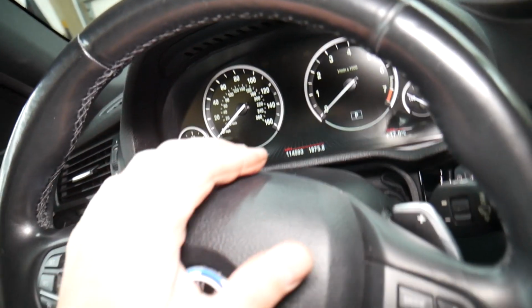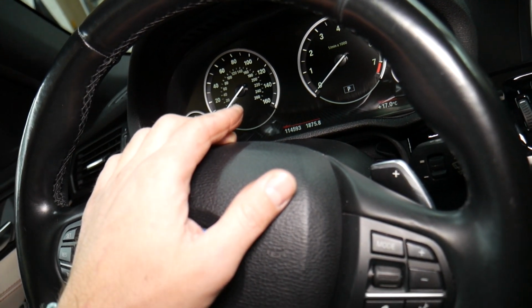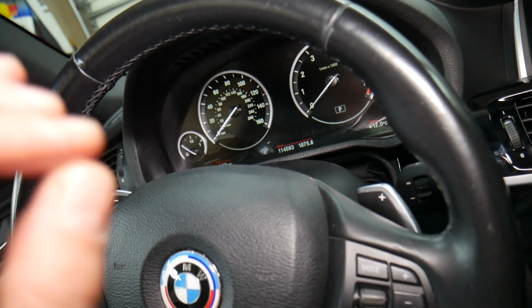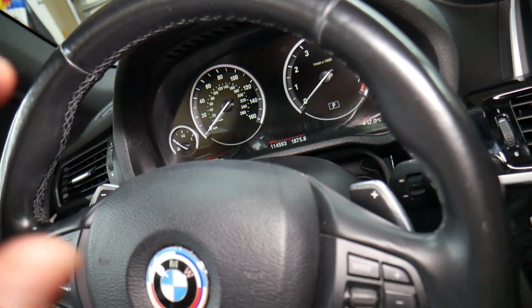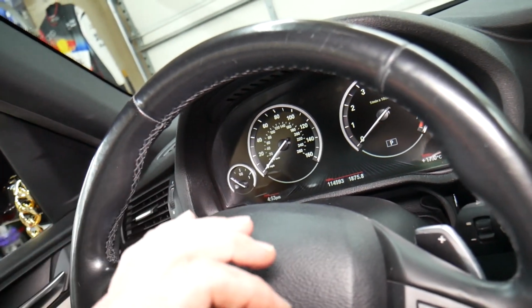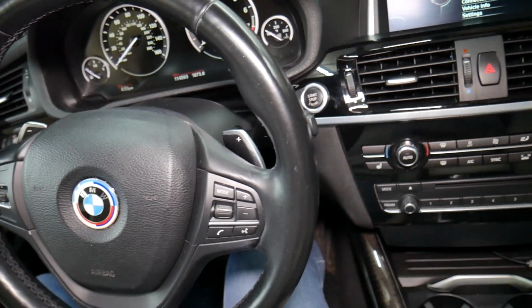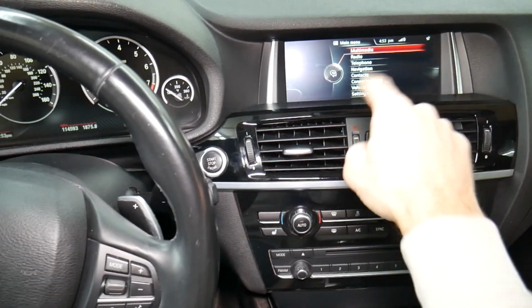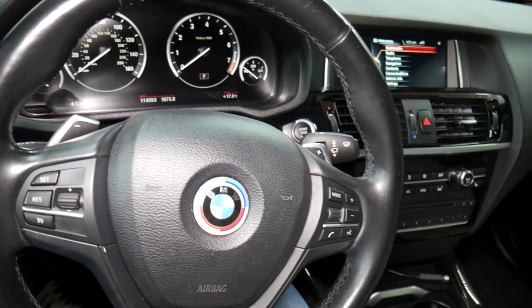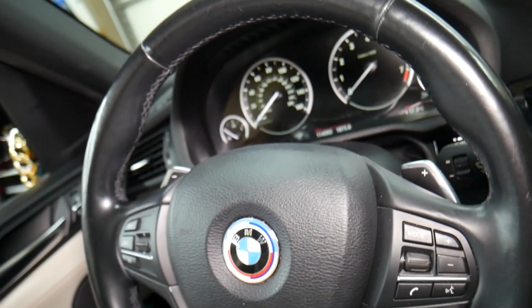The next step, okay, will be to check your oil level. You can do that only after warming the car, so you need to make sure you added about 7 quarts, 6.9. Drive it for 10-15 minutes. Make sure no oil lights pop up or anything like that. Stop and measure the oil level. For any of you that want to see how to do that, we'll have the video on the channel, because you do it through the computer here, okay, through the iDrive. You don't need to go outside and pull dipsticks. You don't have a dipstick on that engine. Hopefully the video will be helpful.